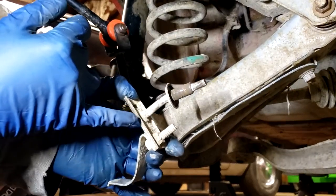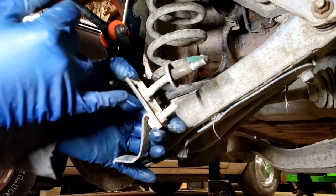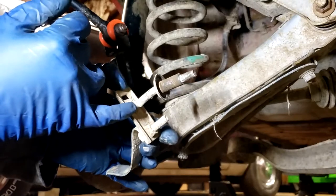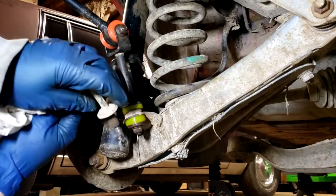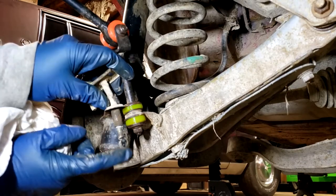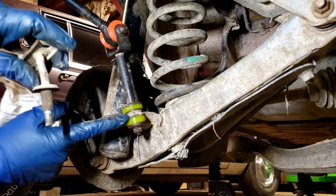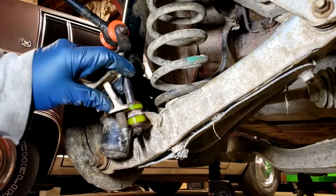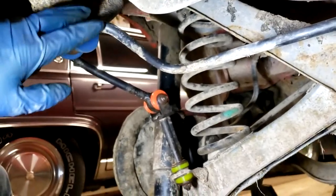It's almost the same process for the front. Here is the actual mount off of the front - unfortunately, this car while off-roading had the front sway bar snagged on a rock or something and ripped it completely off, so you can see this one's a little bent. It's essentially the same thing: you've got the cup washer - except this one is welded on - then the steel sleeve, another washer at the bottom, and the washers in between that are solid to the car. It's essentially the exact same process for the front.